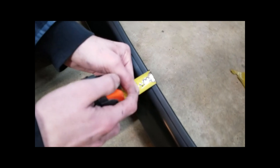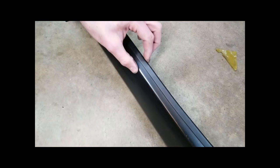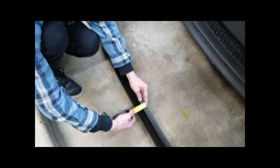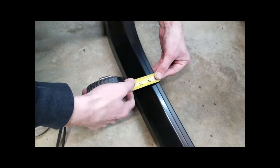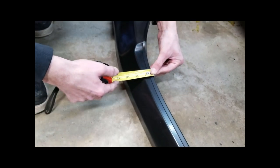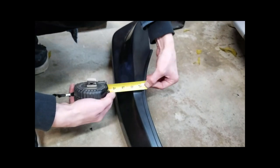is, what is that, 7/8 of an inch, almost an inch. You can see it there. So that's where it hits this body line here. So it's pretty far. It started out probably up here, and then you pretty much maintain that. So here's the center line. You maintain that at about half an inch to an inch. But then curving here, it gains a ton. So right at the bottom of this curve, you're at 1.5 inches, and then off to about 2 inches.